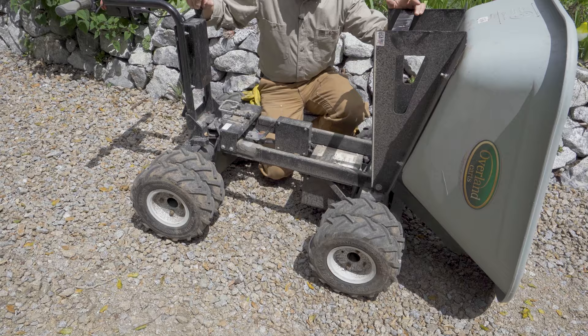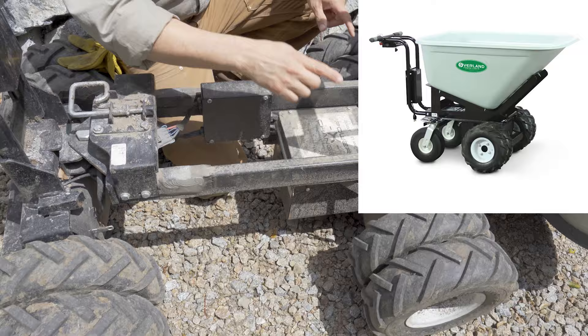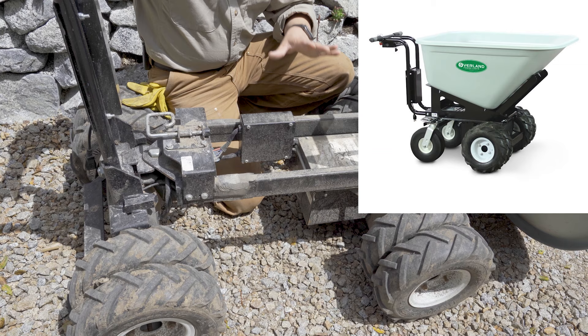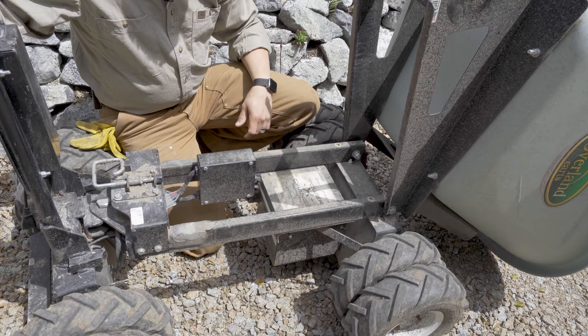The big reason for that, according to Granite Industries, is that if you get the two-wheel drive model, it's a near-zero-turn-radius cart because the back wheels are castered, and we have essentially the same front axle as on this model — allowing it to turn in really tight circles. However, if you get the four-wheel drive model like this one, it obviously cannot turn in those tight circles anymore. So I think it is a little bit of a limitation that we don't have a limited slip differential.